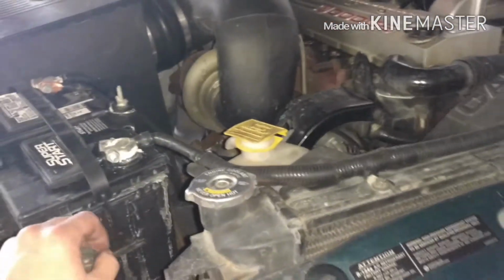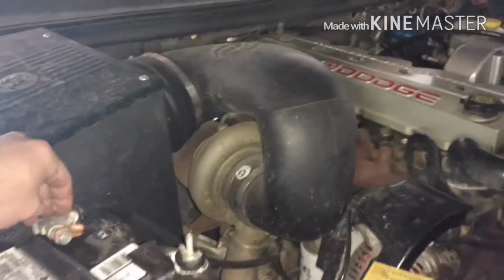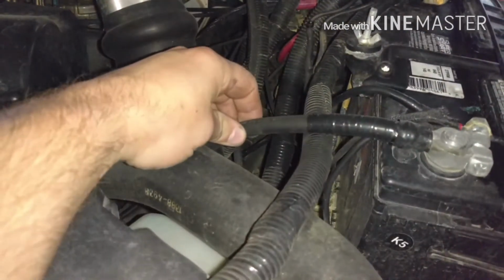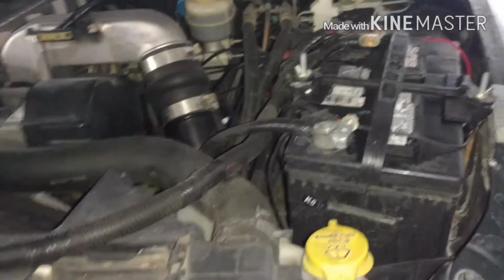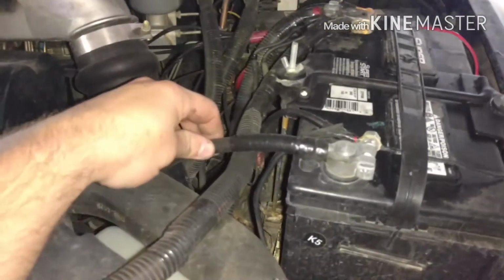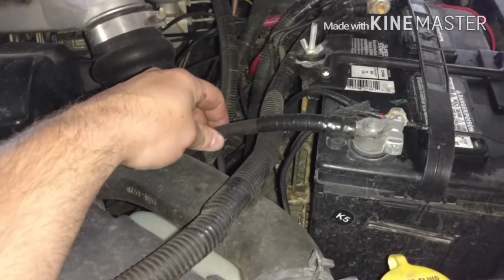All these battery cables, I got connectors, any secondary posts that I had to wire in. I got all thicker cables. This is all 2-gauge cables, even for the negatives. Your positive cables are 2-gauge wire. Your negative cables, I think they might be 4-gauge, but I ended up switching it over to 2-gauge, so it would be a stronger current and a stronger ground.